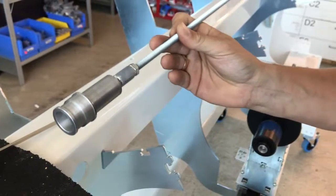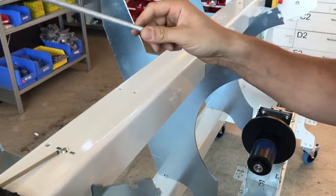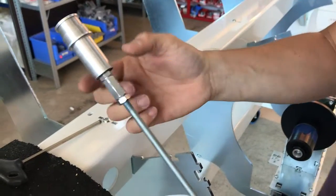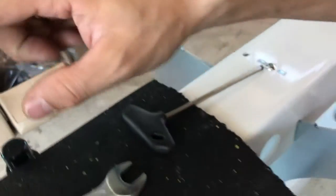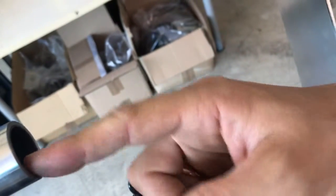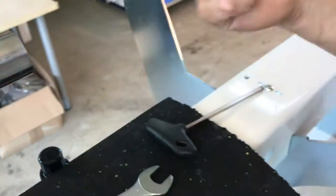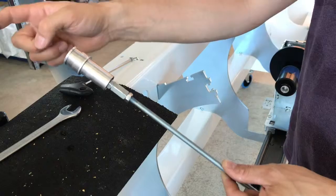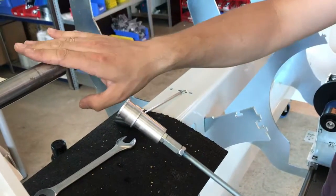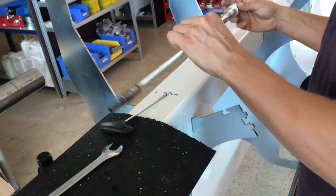The turning decoupling unit can now be replaced, cleaned, or whatever. Always make sure that on top of the aluminum part there is another plastic bearing part — in this case it sits inside the stainless steel shaft. You need to make sure that this bearing is either in there or on this part before you assemble the unit.